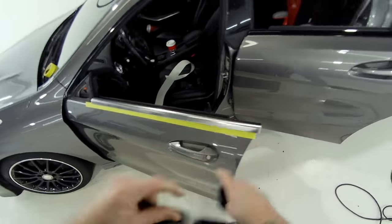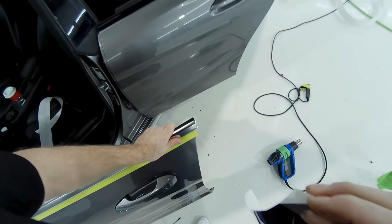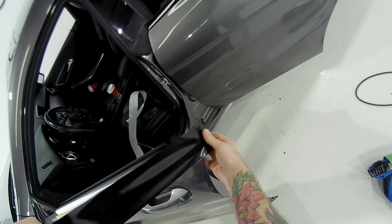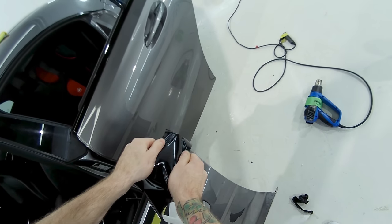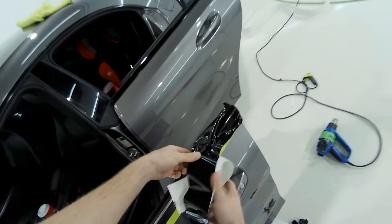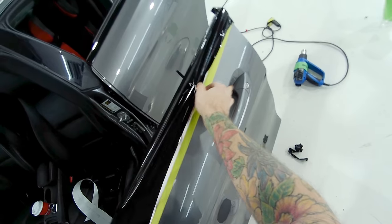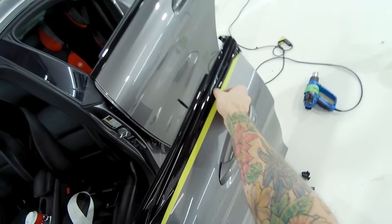Let's grab our piece of vinyl. I'm going to start right here on this side — this side bends more than 90 degrees, while the other end is cut off flush on the very end. Push that down a little more since we're pulling from this end. Put that nice and flat and tension-free. Take the vinyl, pull it across like so — the only tension here right now is pulling across the trim piece, so it will not fail. There's no tension on any of the edges. Pull it across the rest of the way. We just barely made it, but that's okay.